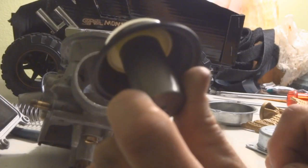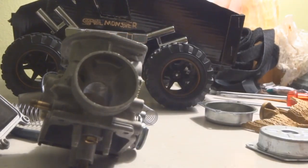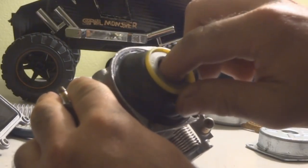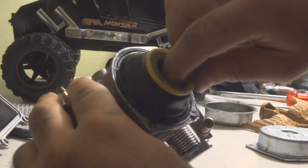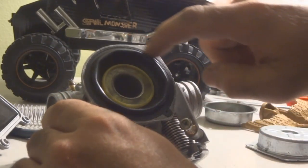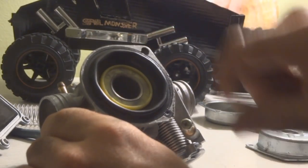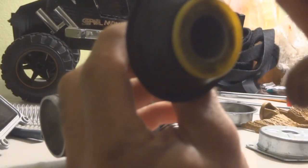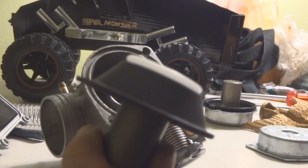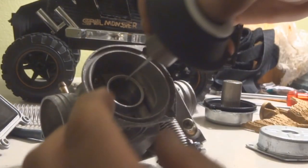The first problem is this rubber is not the correct width — it's 55 millimeters and it needs to be 60 millimeters, so this one is garbage. Here's another one that's about three years old but it's the correct size, 60 millimeters — it fits right in, seals, and fits inside its rail like it's supposed to. Also, you want to hold these up into the light to make sure you can't see any light through the rubber, because if you've got any holes you need to change it.